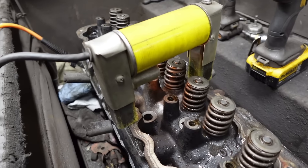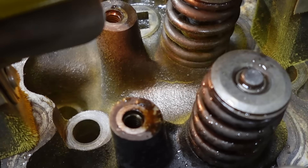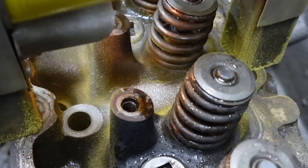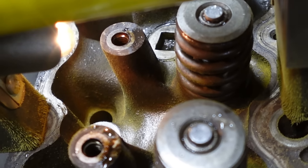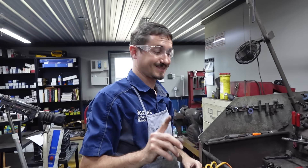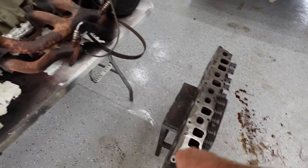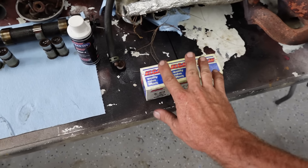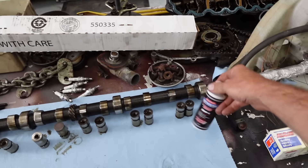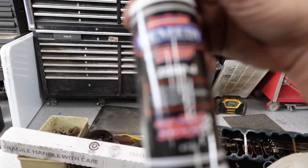He's got it cleaned up. Look at it glow — I could not see that crack with the naked eye. A crack is never gonna get any better. I got a head, so we're set. I'm gonna get a head, cam, and lifters. We've got a new head without a crack, a new set of Elgin lifters — that's the best brand we've come up with, not hard facts but just what we prefer. Same Elgin cam, new cam, and then some zinc additive. Justin made a good point that even Rotella is limited to about 800 parts per million zinc, but flat tappets require 1,200 to 1,600 PPM. So even though manufacturers say not to add zinc, these motors need those numbers bumped up — especially for break-in.